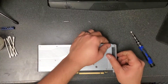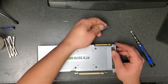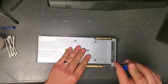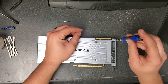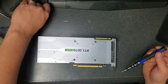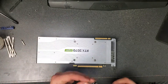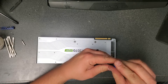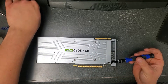Up here is the SLI tab cover, which just comes right off. Then we have an entire array of tiny Phillips head screws — I think there are about 14 of them on the back plate, not including the four that hold the cooler on. We'll take all of these out and get inside to replace the thermal paste, check the condition of the thermal pads, and if it's dirty, clean the cooler and fans.